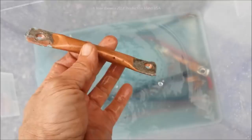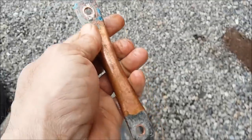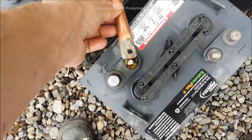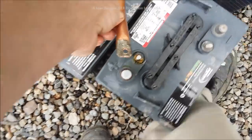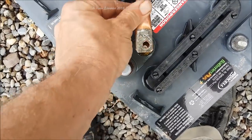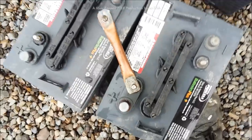In fact it'll make your fingers and fingernails nice and soft too. That's how you clean your cables and terminals — a little bit of baking soda. You can see it all starting to come off and it's neutralized, it's safe. In this one's case, I use these to put batteries together — just bolt them in like so — and you've got yourself a 12-volt battery.